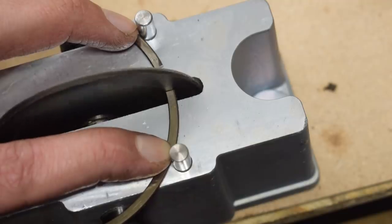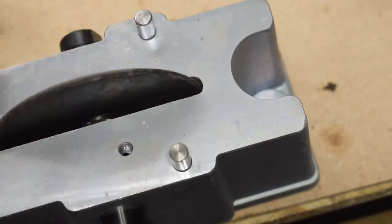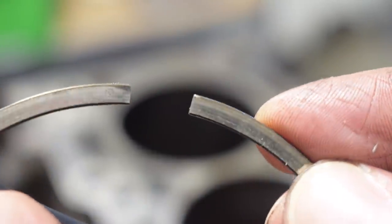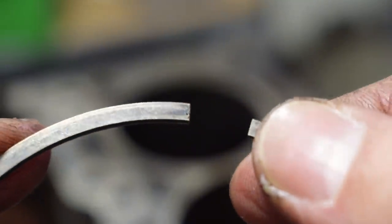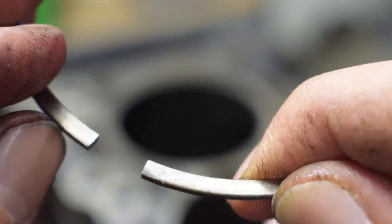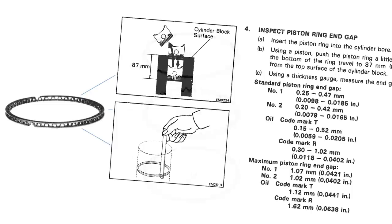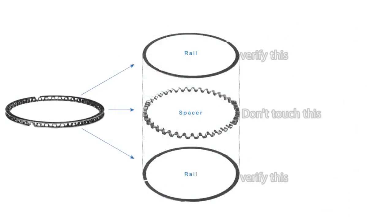Do not file too much. When it comes to piston ring gaps, it's better to err on the side of caution. If your gap is right at the minimum mark recommended by the ring manufacturer, it's a good idea to expand it just a bit above the minimum — it will cost you a fraction of a single horsepower, but it could save your engine. Once you achieve the proper ring gap, inspect the ring ends and if they need to be deburred, use very fine sandpaper to very lightly deburr the edges. Do not chamfer the edges in any way. In most cases rings will not need deburring, and you should only spend a second or two with the sandpaper. When it comes to the oil rings, they almost never need to be gapped — you can consult your factory service manual and simply verify that the gap of the rails is close to the maximum or in the second half of the range if you're adding forced induction or significantly increasing boost. Do not touch or modify the spacer in any way.